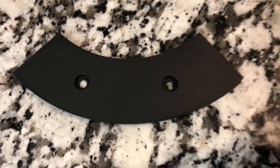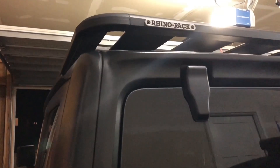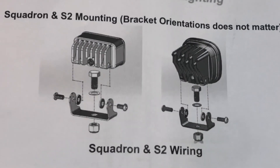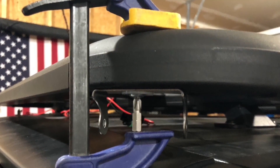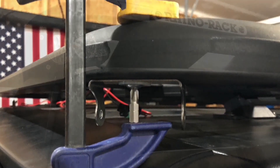This is one of the two lower corner plates to the rear corners of the Rhino rack. One of the two mounting locations for this plate is an almost perfect place to mount the light brackets. I used a quarter inch longer screw with non-permanent blue thread lock and nylon washers to allow the brackets and attached lights to easily rotate towards the side or rear of the Jeep when needed. It is challenging to get the screws in as the space is tight — a clamp, Phillips head bit and pliers come in handy here.